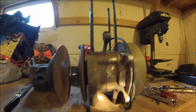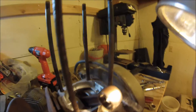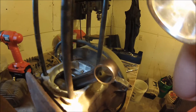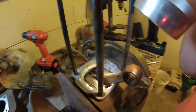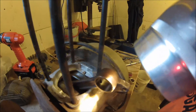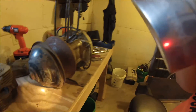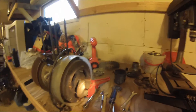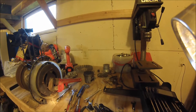As long as I've got it apart this far, I'm going to split the case too. Last time I worked on a sled I didn't do anything with the bottom end and the crank seal went out and the motor blew up, so I'll probably put new crank seals in it if I can find them, just because it's been sitting so long — that rubber wears out and bad things happen. Right now my hold up is getting the primary clutch off and then getting the flywheel off on this side, so if I can get my hands on an impact that'll probably help out quite a bit.